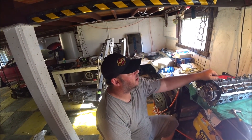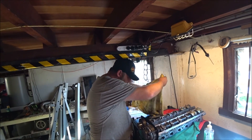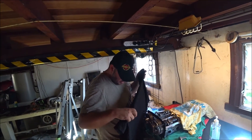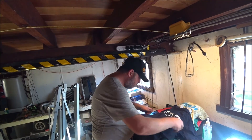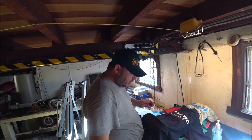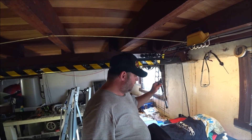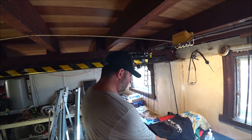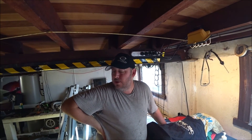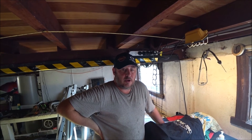Obviously that'll hold some sort of bracket or cover thing. The head is done — I'm going to cover it with rags again because I don't want debris or dust going in. This has only got oil and assembly lube on it. The fact that it's dirty doesn't mean anything because all that dirt is the same as what's already in there. And that'll stop dust settling on the cam or inside the head. Pack her up for the day because I've got to go grocery shopping — the head's not going to get on today, though maybe it will if I come back later tonight. The next step is to put it on the engine, then probably take half of that timing gear off to put the timing belt on later.